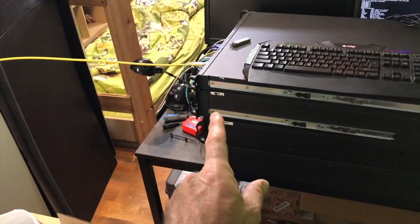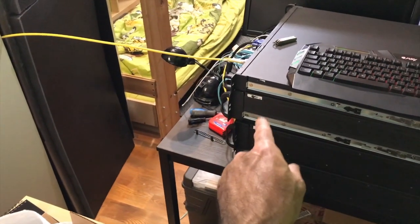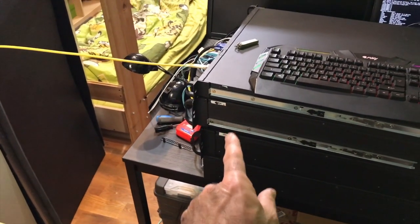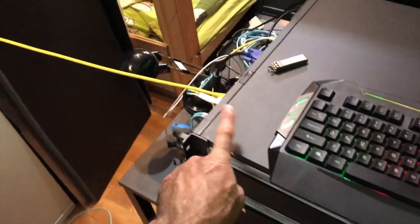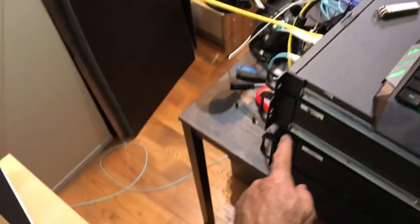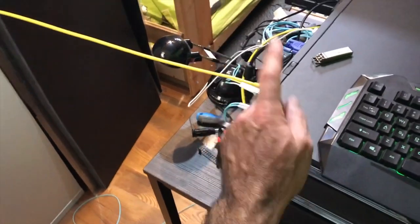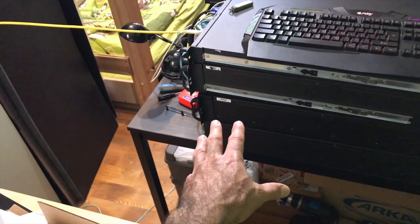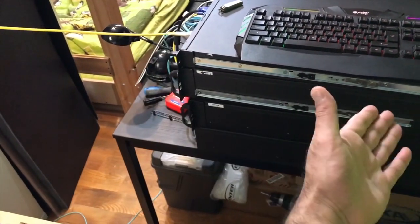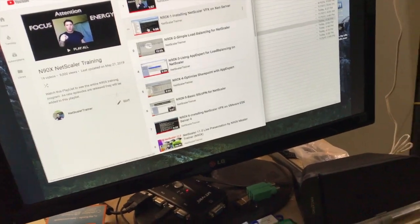But I said, the main thing is that I wanted to use the 10,500s, but because the riser cards don't support the number of X8 slots that I need, this guy has the X8 slots. All of the slots are X8 on the riser card, whereas this one has, on one side one X8 and 2 X4, and on the other side 2 X4s. So not really able to handle the 10 gig board, but this just worked just flawlessly. Following this man's instructions here. So just another idea for you to utilize.